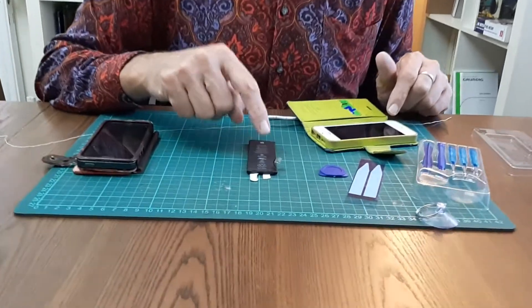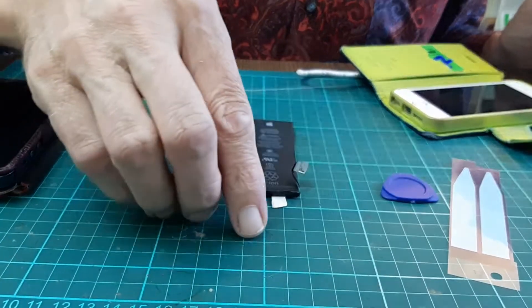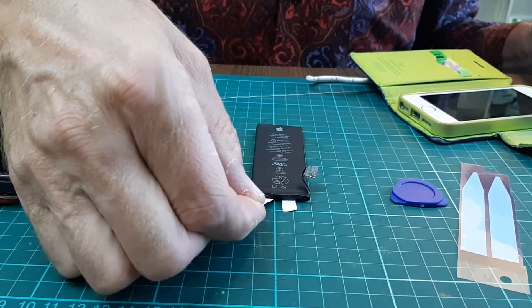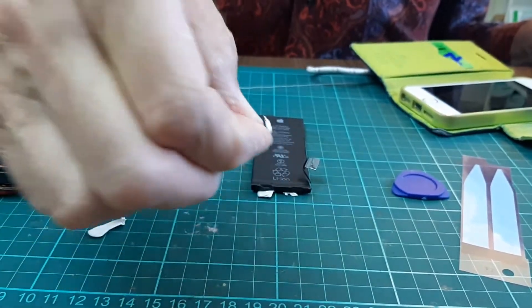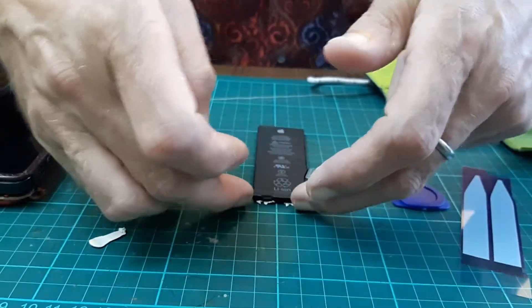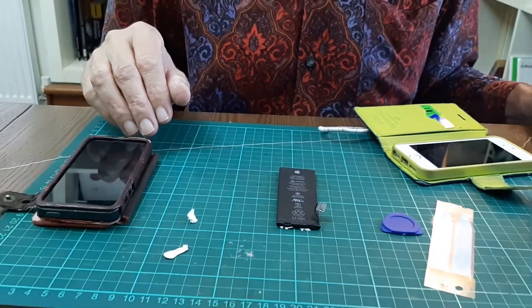Here I'd like to have a look at this battery. This is the original Apple battery that came out of this phone, and I'm using blue tack — or white tack in this case — to simulate what went wrong. The idea is that you have these adhesive strips and you're supposed to pull them out carefully. But then — oink — it goes straight back underneath. You get another one and it gets worse and worse. The adhesive strips have gone back underneath the battery and it's still stuck like a rock.